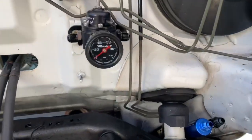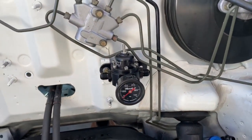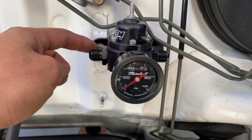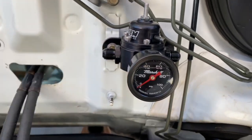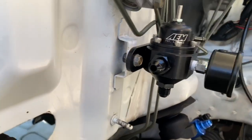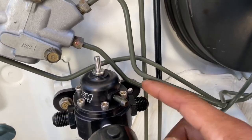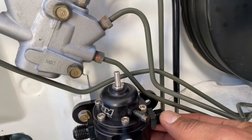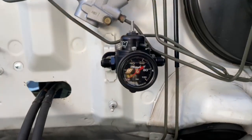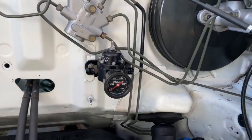Just showing you guys how I mounted the fuel pressure regulator — came out real nice and clean. This is my first time mounting it right there. Originally this brake line goes on that black clip that used to be there, so there's already a stock hole. All I did was use a factory 10mm bolt and 10mm nut and tighten it down real good. Then I'll probably zip tie or metal tie it to the brake line so it holds it up in case it ever vibrates loose. I just hate drilling holes and cutting into cars if we don't have to.